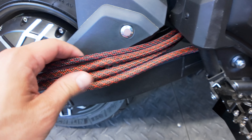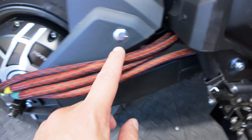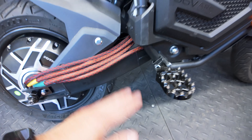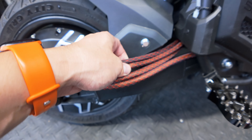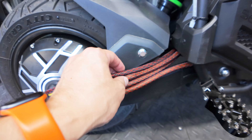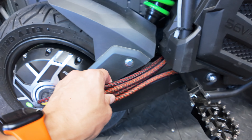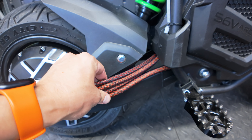When I initially mounted these, I had them zip tied and also put a neoprene sleeve over them. When I sent that to Ryan Goodyear, he mentioned to take the sleeve off because one, these need to be cooled, and two, you actually want these things separated. You don't want these things squeezing together because on load, these phase wires will heat up and with enough power and enough heat, they'll actually melt into each other. Now there's a lot of insulation — I'm probably not going to run this super high — but it's probably ideal not to keep these things super tight.